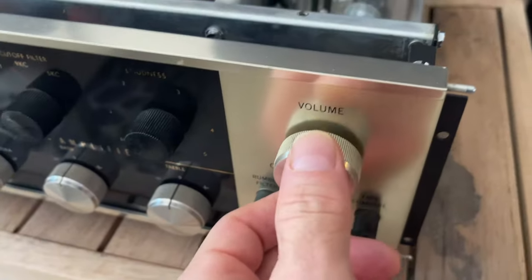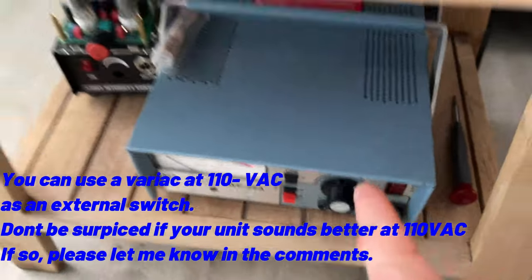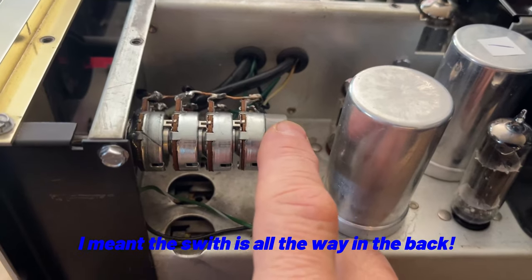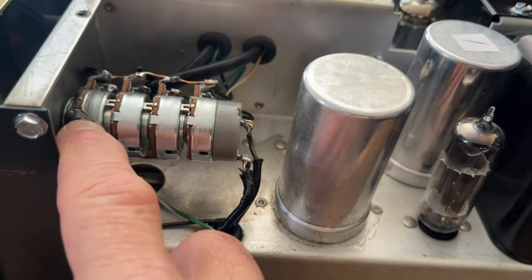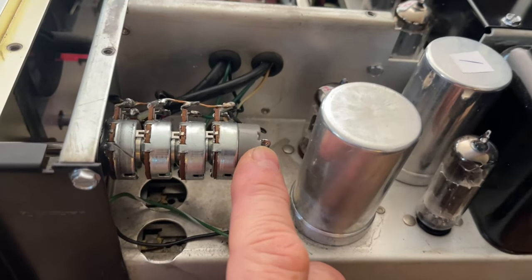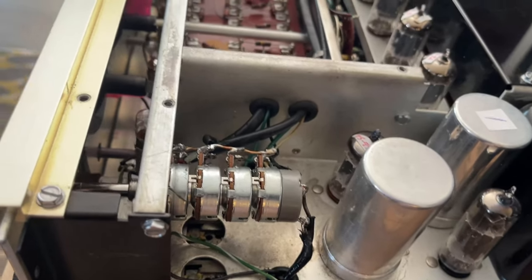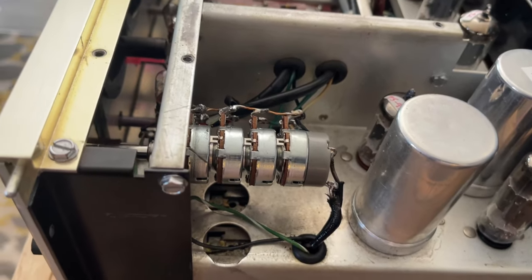I would strongly recommend you don't use this switch directly. Put on an external switch or use it on a variac at 110–117 volts. The switch is already in the back and these units are anchored all the way in the front. So every time you flip the switch on and off, you're applying torque through the entire assembly. There is a certain degree of deformation — there's elasticity in the metal. Every time you turn this unit on and off, you can only do that so many times before the assembly starts shifting and you start losing tracking. It just applies too much torque to the entire assembly.